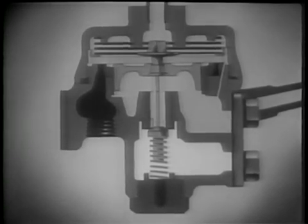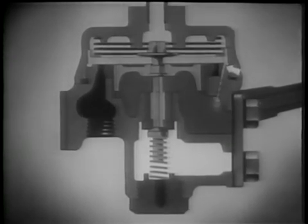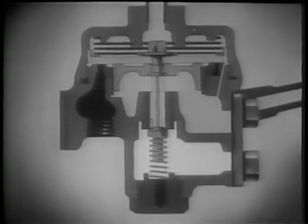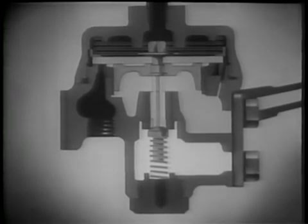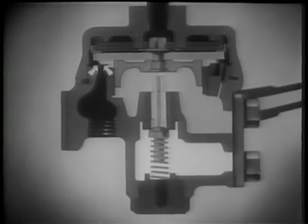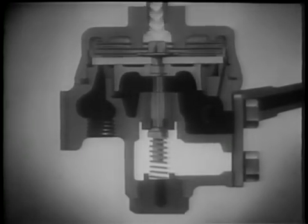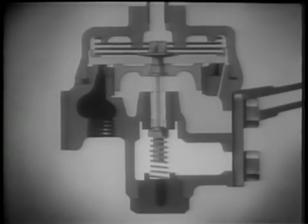After a long period of service, wear may produce a slight variation of pressure above and below the diaphragm. The bleeder or bypass port corrects this error. When the brake pedal is released, the air above the diaphragm escapes by way of the brake valve. The pressure below forces the diaphragm up. This opens the exhaust port and allows the air in the brake chambers to escape directly. All these actions take place at the same time. They have been slowed down for the sake of clarity.